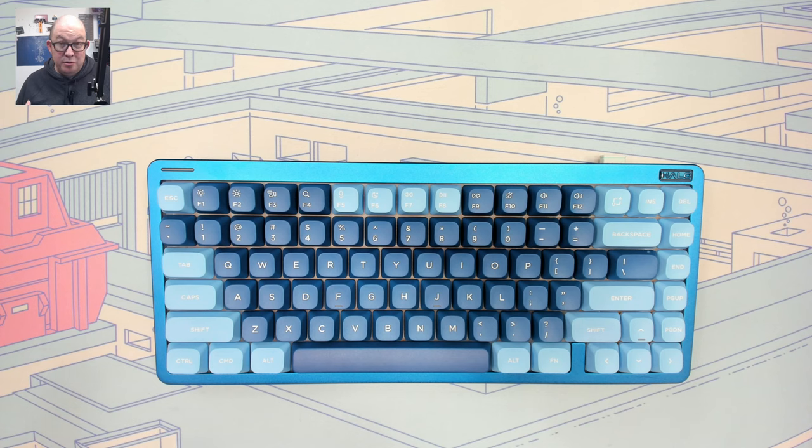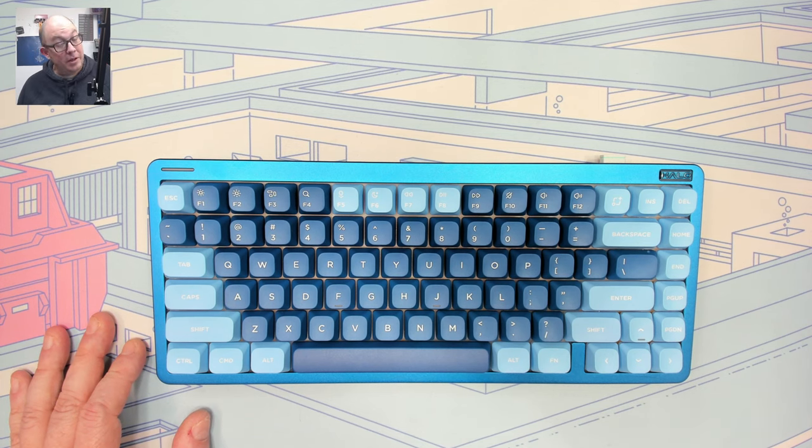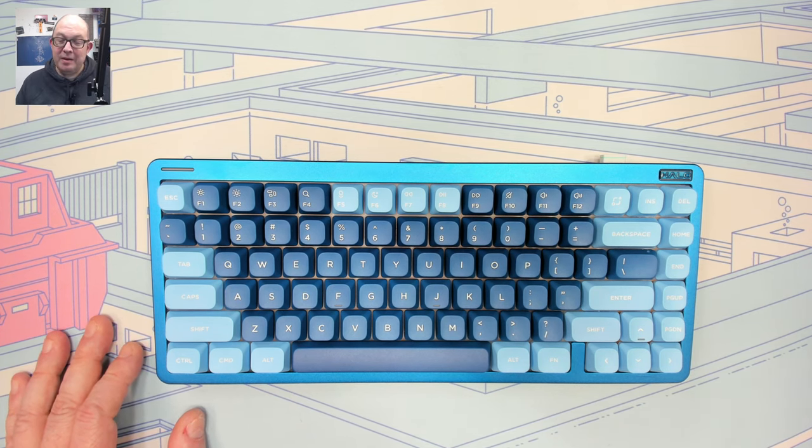We have to first go to the NuPhy website, go all the way down to the footer, so just hit the End key, and then from there you have to click on consoles. We're not looking for console, but you have to click on it, and you'll see the software for the top list of the models, and they've just recently added Halo75 V2, so you click on there. Then you click on the Via configurator, which takes you to another page, which tells you to download the JSON file. There you can get to the link where you will download the JSON file for the Halo V2. At that point, you want to go back to Via, go to the settings tab and enable the design tab. It's going to give you a warning. Don't worry about it. Then go ahead and load up the extracted file from the zip that you downloaded from NuPhy.